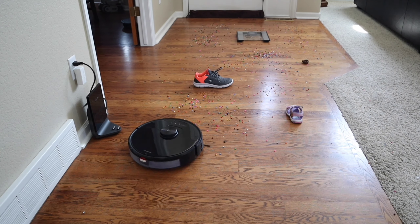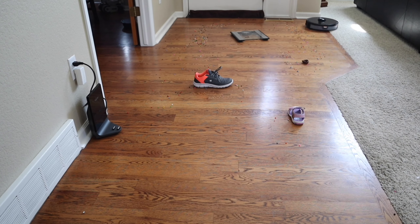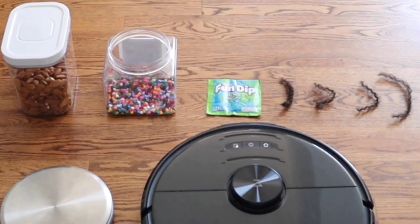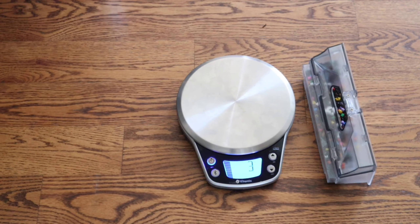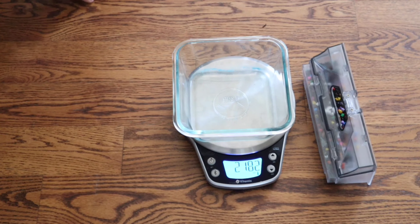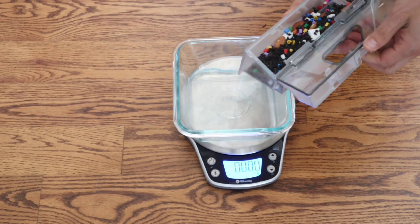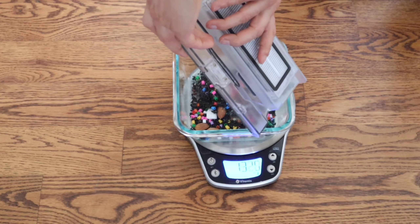The S6 Max V is one of the first commercially available products that can successfully navigate objects and recognize them by its camera. And yes, it does recognize poo. One thing to note is the robot did forget where the poo was at the very end of this challenge, but that's just one thing Roborock can work on — hopefully over time with its reactive AI system, it will just get better. For the pickup challenge, we're going to use hair, powder, candy, small beads, and also almonds and some rice. I'm going to take a different approach in testing: I'll actually use a used filter, dustbin, extractor bar, and side brushes — not everyone's going to have a brand new filter. This helps evaluate the durability of consumables and the true nature of these robot vacuums. It's recommended to change out filters and consumables every 3 to 6 months depending on use.